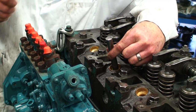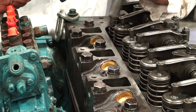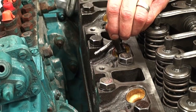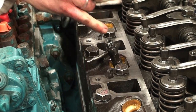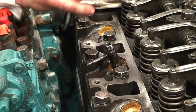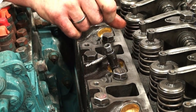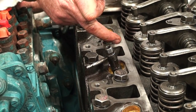This tool will bottom, which indicates where the tool ends up. You can see it's slightly below the surface — there's lots of sealant around there, and that's going to provide the sealing we need. Then we would have a lock that holds it down into position, and our fuel return and supply lines would be installed. There is also a dust boot that goes on top. When technicians are checking for leaking sleeves, the dust boot can be pulled up and soap and water can be sprayed on a running engine — a compression leak will cause it to bubble. That's one way of diagnosing that the sleeve is damaged.